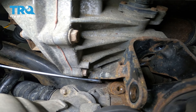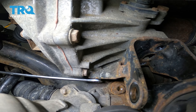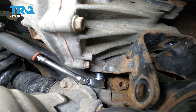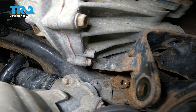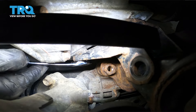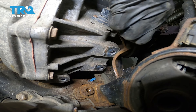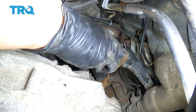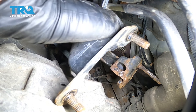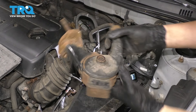Take the wheel off. We can get a wrench on there and hopefully break it free. We can't go far with this ratchet, so let's see if a ratcheting wrench will do the rest of the job — otherwise the ratchet will get jammed up between the steering rack and that bolt. There's the third bolt. Now we can move this bracket out of the way — whether you remove it completely or just leave it there is up to you. And now we can remove this mount. There it is.